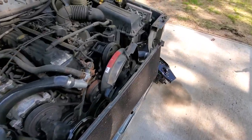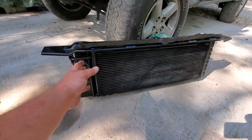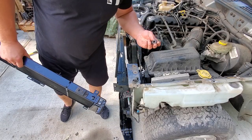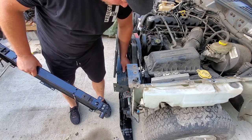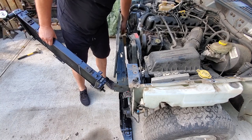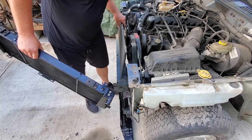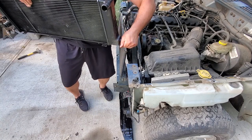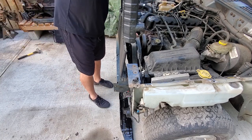All right, let's go ahead and we'll drop this bad boy in. Actually, I already have a condenser here, so I'll have to take that one out. All right, radiator's gonna go in, and I'm gonna want to put in these rubber bushings. These drop right in these frame holes over here, either side. Then we'll line up the good condenser right over those holes. We're gonna drop the radiator. Well, first, make sure that petcock is tightened. Good. Do it while you can get to it, right?